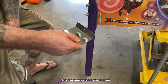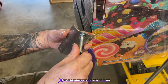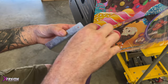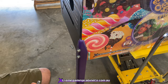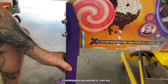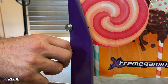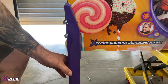I just want to explain what's on the inside. The bolt is going to be screwing in and twisting into a threaded insert inside the machine. You do it by hand — you don't want to force it, because if you force it and it's not going in smoothly it can break the seal and it will just keep spinning. You won't be able to tighten it. So it's all hand-tightened. When you get the bolt started, take the weight of the leg so it's not bearing down, and just twist it in by hand all the way — don't force it, just hand-tighten.